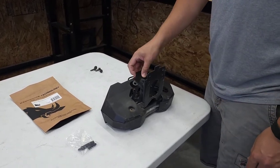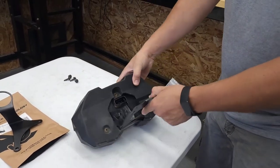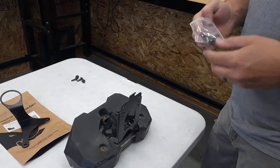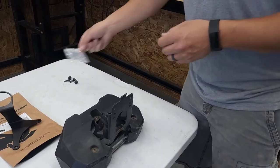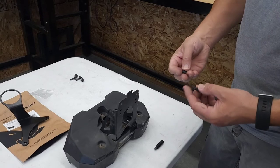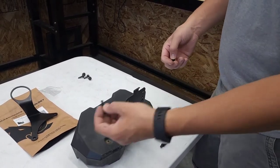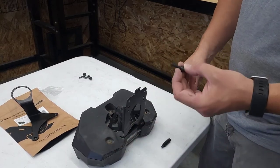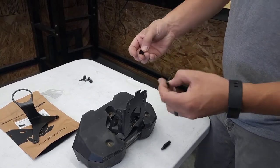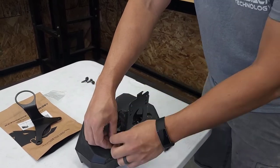It's going to be going on like this, and the brackets come with some hardware. These bolts are going to have some spacers. The one on the left and the right side is going to be this small bolt, and you're going to have this spacer that will go on there. It actually goes on there — spacer first, then the mount, then the bolt.